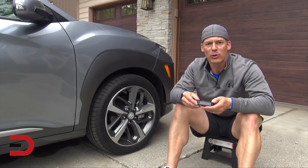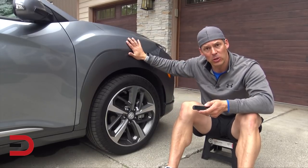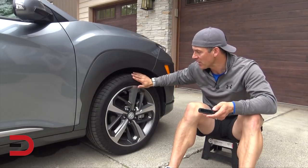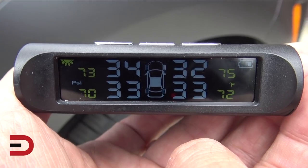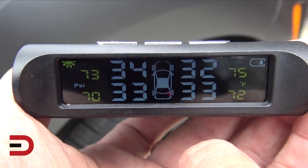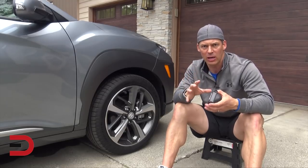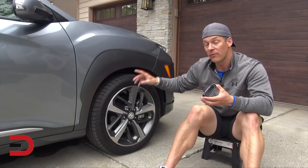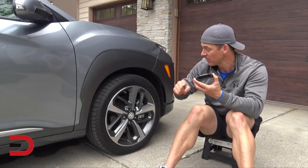It's been a few days since I last recorded, and I have a new press vehicle. I've put the tire pressure monitoring system on this vehicle to show how it works. This tire has a PSI max of 50, and it's showing between 32 and 34 PSI on the LCD readout. The temperature is reading between 70 and 75 degrees. Now I'm going to demonstrate an interesting and great safety feature — I'll remove this sensor so you can hear the device make a sound.